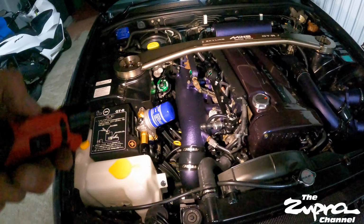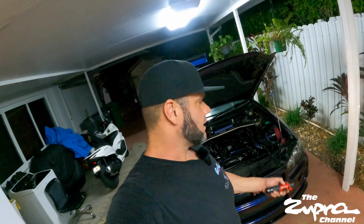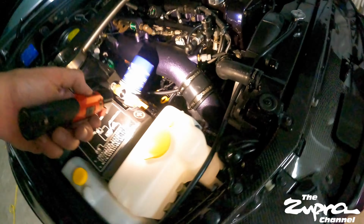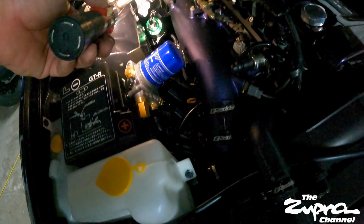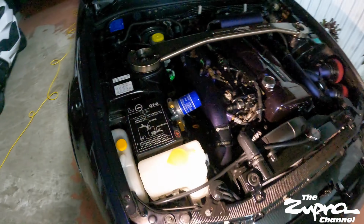It was the resistor for the injectors, man. You switch over to high impedance injectors and they just need to be grounded out together, or they're all merged together. You just bundle up the connector over here. I tucked it away now, but it's all gone. It used to be that factory resistor that was here, so that's no longer being used.